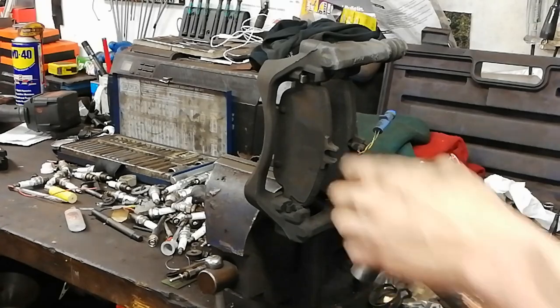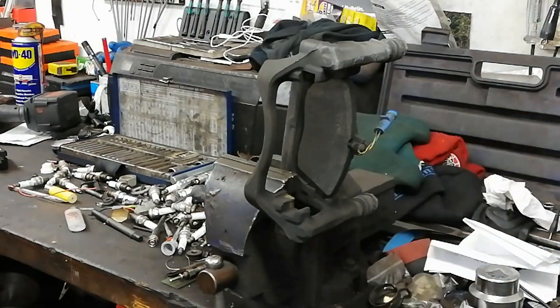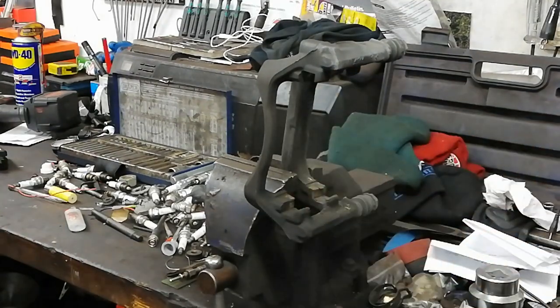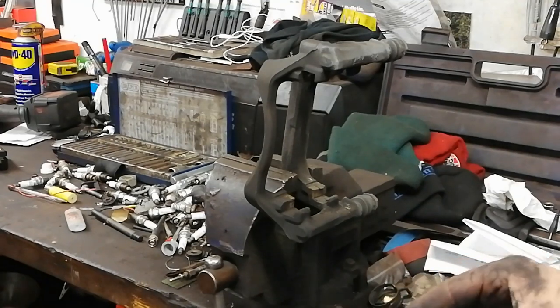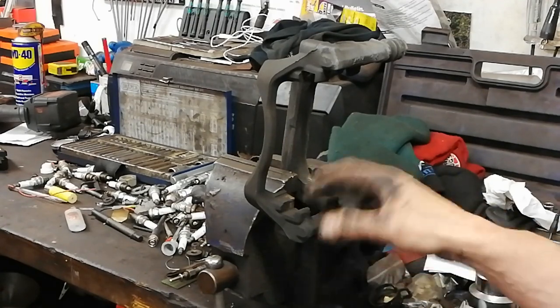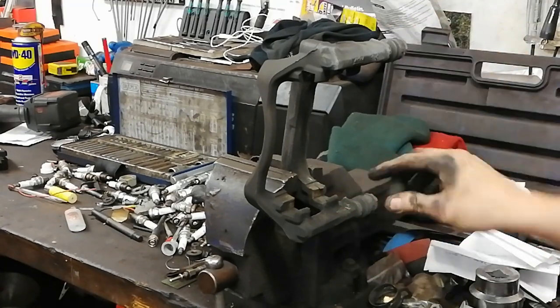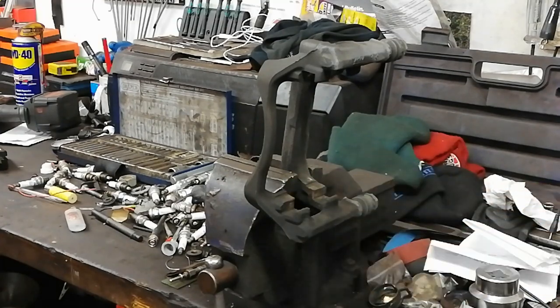So we've got the carrier bracket in the vise, so we're just gonna tappy tap tap. Get these out. So that's them there. Right, wee bit left on them. Not a big lot. So, yeah, I recommended the owner, so we need to dress all that up, give us these wee bit of grease. They're nice and free anyway, but we'll give them a wee bit of grease. But the main thing is getting these cleaned up so they don't jam up in the future.